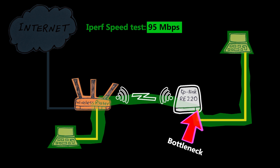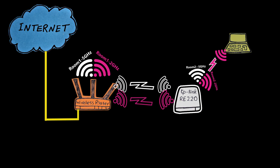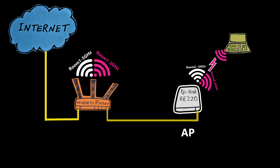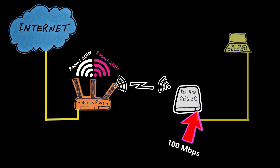So is that really a big deal? Obviously not for many people who only want to use this device as a repeater to extend the range of their Wi-Fi for wireless clients — they're not even going to use this port. But if somebody wants to use this device as an access point or a client bridge — to connect a wired device to the network — they should be aware that 100 megabits per second is the maximum speed they can reach, even if the wireless link is faster.